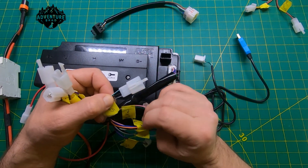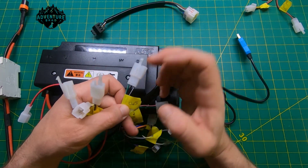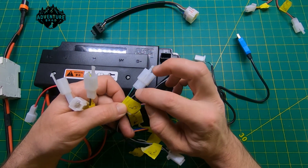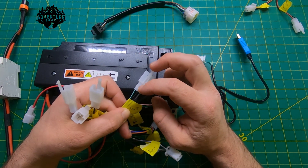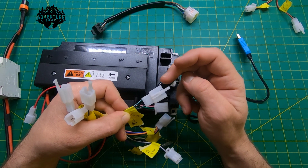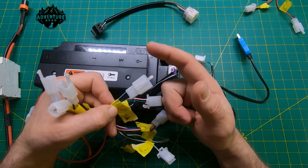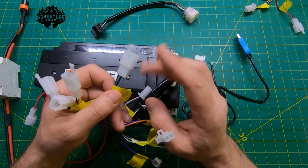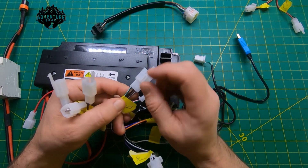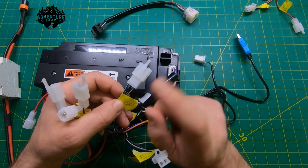The speedo plug is also a three-speed plug. You can operate it as a two or three speed — you can select that in the firmware. The center pole is ground. The black wire on the end with the white stripe is high gear — hook that to ground for high gear. The far outside green wire with the white stripe is low — hook ground to that for low gear. With a single-pole double-throw switch you can switch between high and low speed, which on my SurOn build is perfect for the eco and sport switch. If you leave everything open, it defaults to second gear.